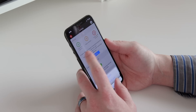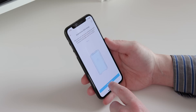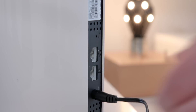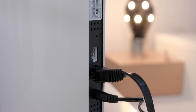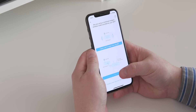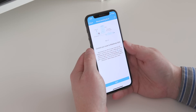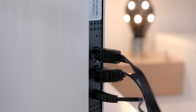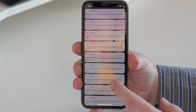The setup process is extremely easy. Start by downloading the Bitdefender Central app on your iOS or Android device. It will prompt you to create an account and then walk you through setup, which takes about 10 minutes. First, plug in the Bitdefender Box and go back to the app. Next, connect it to your modem, then decide whether you want to use it as a standalone router, use your ISP-provided router, or use your own router. If using your own router, follow your router manufacturer's instructions for putting it into access point mode, then connect the Bitdefender Box using a separate Ethernet cable.